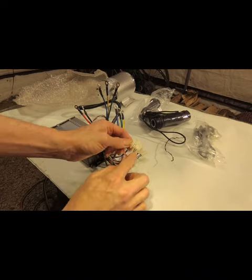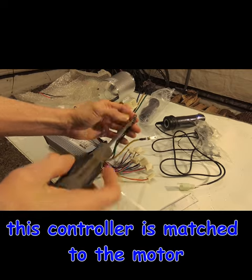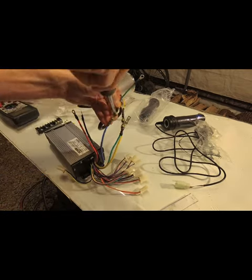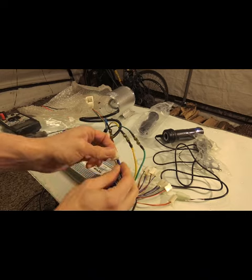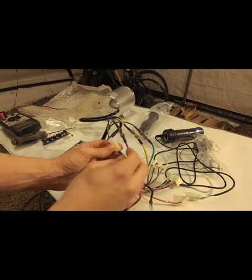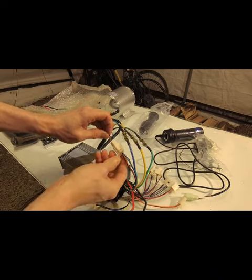The electric lock throttle wires correspond with the same color of the motor pieces on the terminal block. We have the phase wires hooked up and the hall effect sensor wires — we'll just plug that in. Then we'll do a quick check to make sure they correspond from this plug to this plug: blue to blue, black to black.